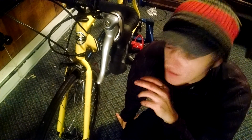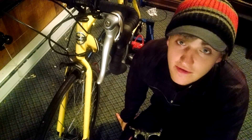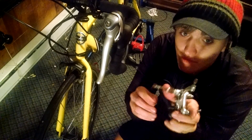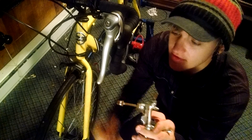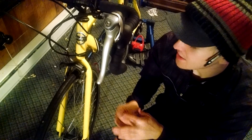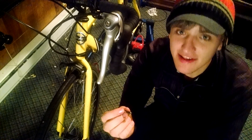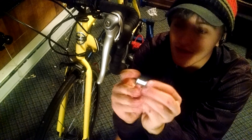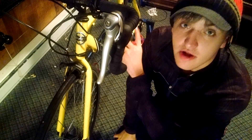The one thing you've got to keep in mind when switching to these brakes is they are a different type of fastening system — I forget what these are called. For these, you can see here that there is one long bolt, and there are a few washers and whatnot that go on, and you screw it, and that goes all the way through the fork. On these, the bolt does not go all the way through — it has an internal system. And then you have these special washer-like nuts. You'll notice that they are thinner, and then they have this fat part.